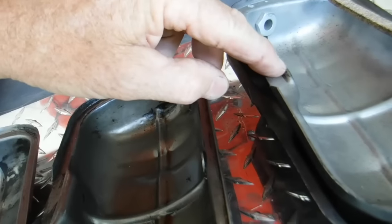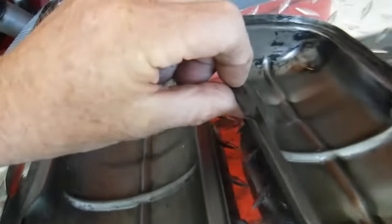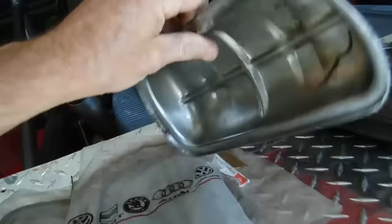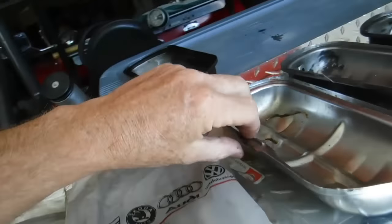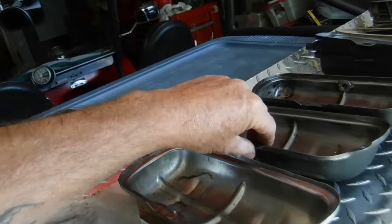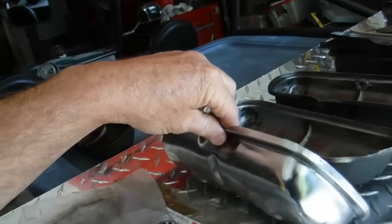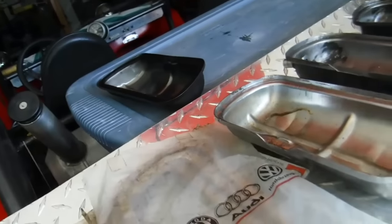Take notice — this one has a little pressed-out part, a dimple that's pushed out. Here's one that doesn't — it's just smooth. This chrome one has got it. Now I don't like chrome. This probably came with a car I purchased. Chrome does not dissipate heat. These valve covers are part of your cooling system — they're constantly having oil splashed on them, and they reject the heat. Chrome doesn't reject the heat as well as steel. Chrome don't get you home.